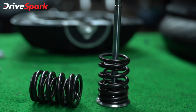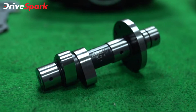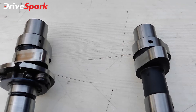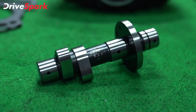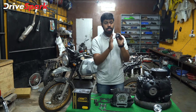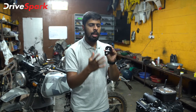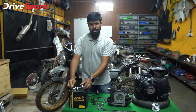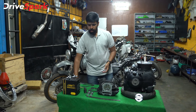These are the NMW Racing performance valves — you've got the intake valve which is 39.5mm and the exhaust valve which is 36.5mm, so they should make your engine breathe better. You've got the valve springs here as well. This is the camshaft going into this build — in episode 1 we showed you different types of camshaft for the Himalayan from NMW Racing. This is the one without the decompressor. If you look at the cam lobes, this has a higher duration not just higher lift, which makes the engine suck in and throw out more air. You've also got the oil pressure sensor.